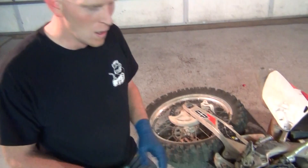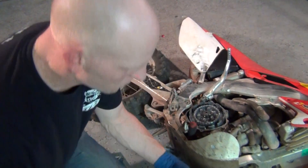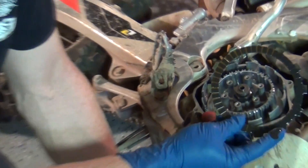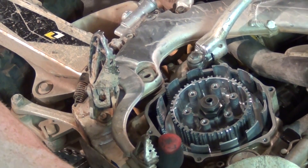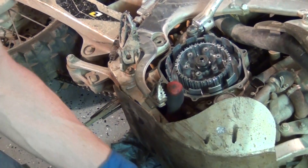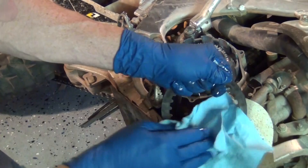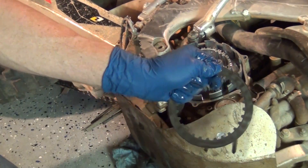So let's show you some of what's going on here. The way that a motorcycle clutch works is you have friction discs like this. These basically have brake pad material on each side of them. And they're sandwiched in between what we refer to as steels — there's a steel disc. You'll notice this is a wet clutch; it's immersed in oil, like in an automatic transmission.